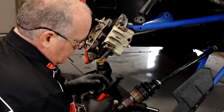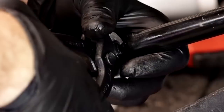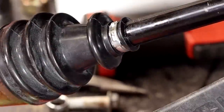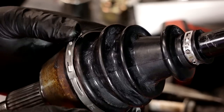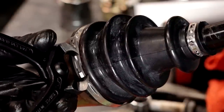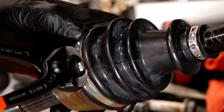We're going to use our clamp tool to grab it from right here to right here — that's the distance — and then we need to pull those two points together until you hear it click. Now you have to be careful with the smaller one because it'll try to crimp up on you and we don't want that to happen. There's the click, and then let it go — there it is. Do the same thing for the large one. This time we're grabbing it from here to here, and as I'm guiding it up, I'm going to keep my thumb pressed to where it'll catch from here to back here once it's compressed on. There it is, and release.